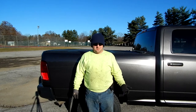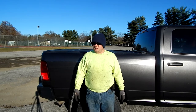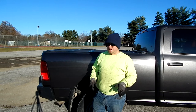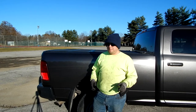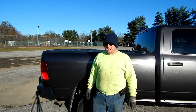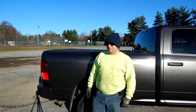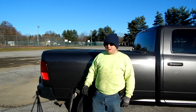I just wanted to show what the Firestone Winterforce LT looks like in that size and explain the importance of why, at the very least, if you're going to run different-size tires as your snow tires, you want a spare tire to match that size. Size is most important, type is next — but definitely the same diameter so it doesn't wreak havoc on your limited slip or four-wheel drive system. That explains why I do what I do. Yes, I have a total of 10 wheels on this truck. I did check the air pressure on the spare — I did it at its coldest and put it at the max 80 psi that tire takes.